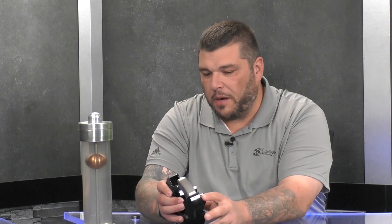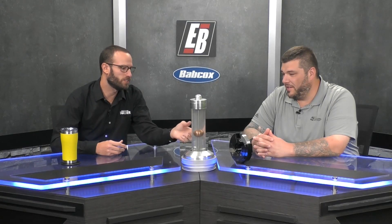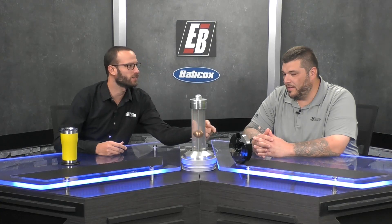So it's just a couple of props displaying what we have. Just like this brass ball being suspended in the silicone, that's effectively what that inner ring of the damper is doing inside the housing unit. The inertia ring is suspended inside the silicone, and as the engine's running, it'll go in and out of phase and self-tunes to the harmonics of the engine.